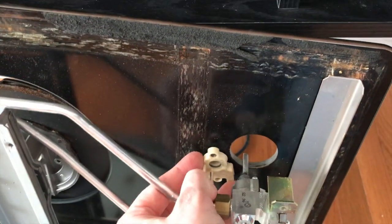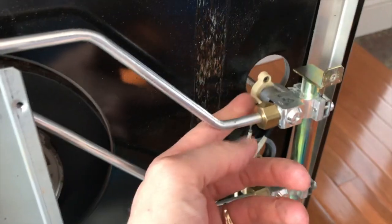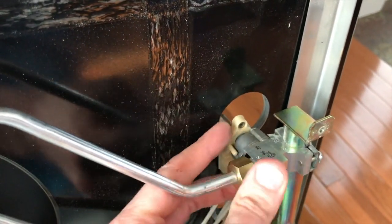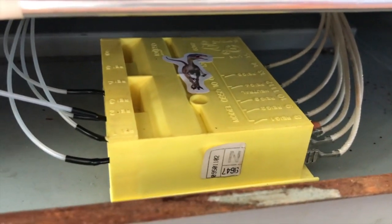Shift this portion of the cooktop or gas line downward and position this properly on the actual rod here and insert it. The new ignition switch is properly aligned and positioned on the rod. Shift it down. From here we are going to carefully lower the cooktop back in place and secure the control module with the two screws.